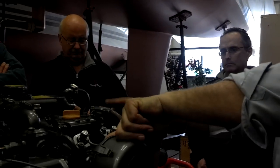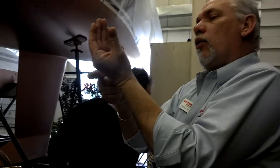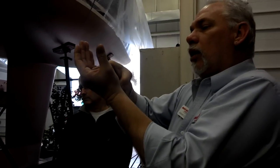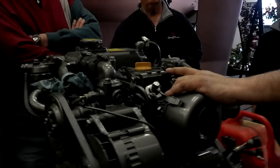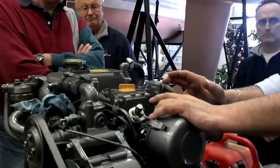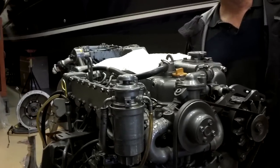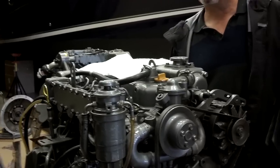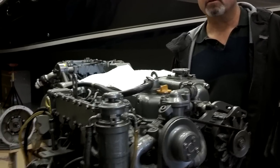What we're doing is taking the air out of the crankcase and recirculating it back through here. On this particular engine, what is here is a baffle. The air comes out of the engine, goes around this baffle, comes down, goes around this baffle, and comes out. And when it comes out, we want to have relatively clean air — any oil vapors or mist that would be in that air gets trapped in this baffle. On that engine over there, if you look on top of that little round piece on top of the valve cover, inside there is a wire mesh screen that traps the vapors — so it's actually an air-oil separator. Will my old engine have one of those too? Probably not.